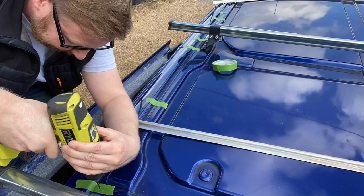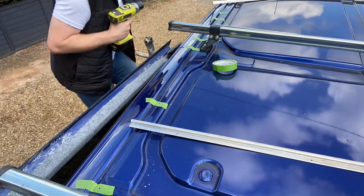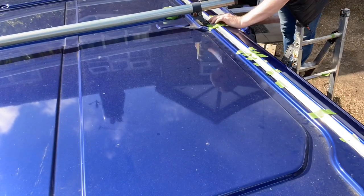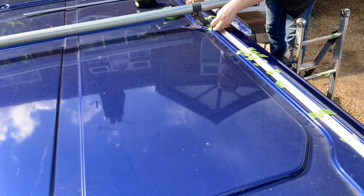The tenth mistake came during the final part of my installation: fitting an awning rail onto the side of the van. The rail came in three separate sections that I had to cut down to size, then pre-drill holes through the rail before screwing into the van's metalwork. One error I made was near the front of the van where drilling hit something more solid. I had to move that screw hole slightly further back towards the bodywork to find the thinner metal section I could drill through.